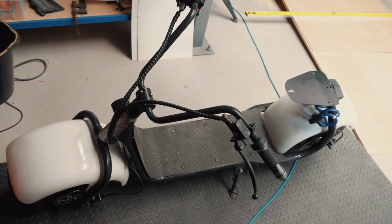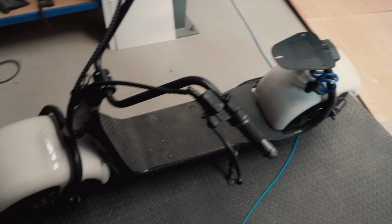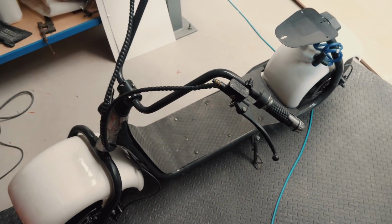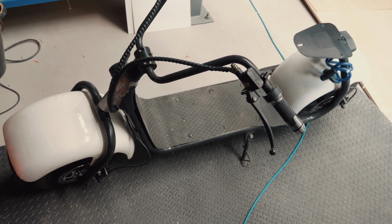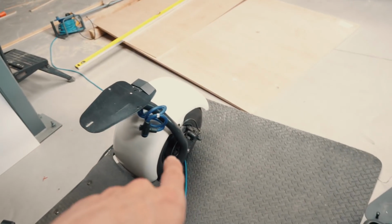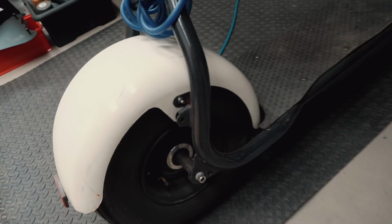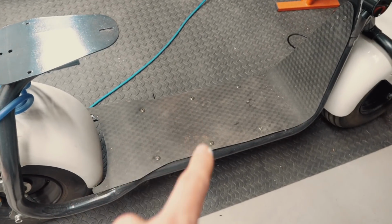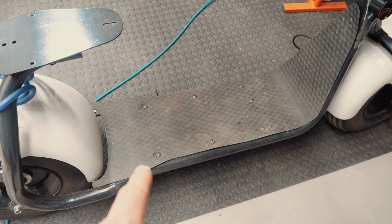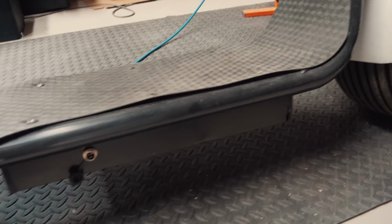Right, so the electric scooter. So here's my baby. I've taken the seat off while I make the seat longer so me and Soap can sit on. I've had it just to trundle around a little bit really. It's 2000 watts, which is stupidly powerful. It's a hubless motor in the back, so literally the wheel itself is the motor inside, and that's 2000 watts, runs on 60 or 72 volt, I think it's 72 volt, lithium ion pack that's in this box underneath.